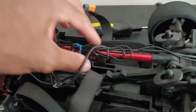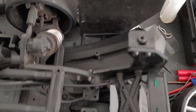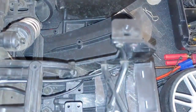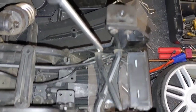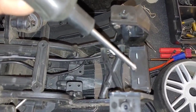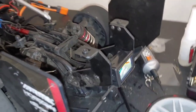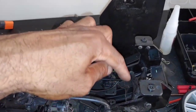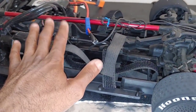For now I'm using bread bag ties to secure things before I put on zip ties or more permanent straps — I want to make sure the wire is long enough to fit down in there. What I did for the mounting is I just cut a piece of plastic and secured it down with two screw holes that are already there. It almost seems like Arrma kind of knew people would mount something back there. I double-sided taped that in, and you guys can see the temperature reading in real time right there. I just unscrew the wing piece to get better access to it.